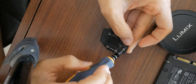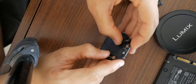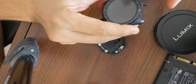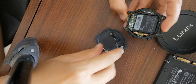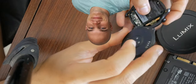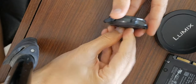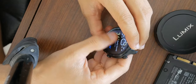It's been about two to three minutes fully submerged. The component goes underneath like so, and now I've got to screw it in. It's going in — looks a little bit cleaner, though there are still some signs of corrosion. Here's the watch completely turned off — you can see the battery is disconnected. First I'll connect the battery — it just snaps on like a little Lego. Then this guy snaps in too. I'm not going to put the screws in just yet — let's test it out. Turning it on. We're in the operating system — let's go to the heart rate app.